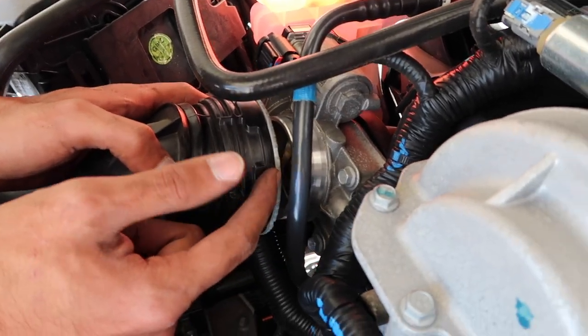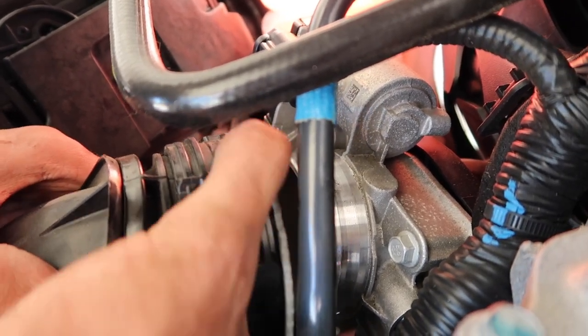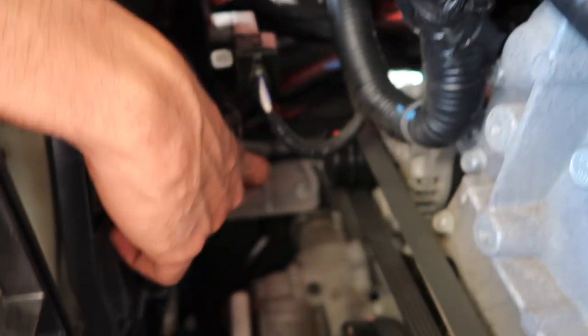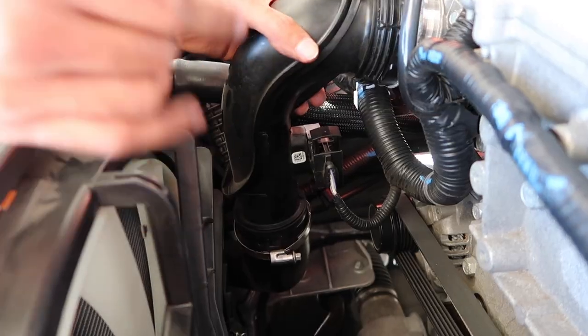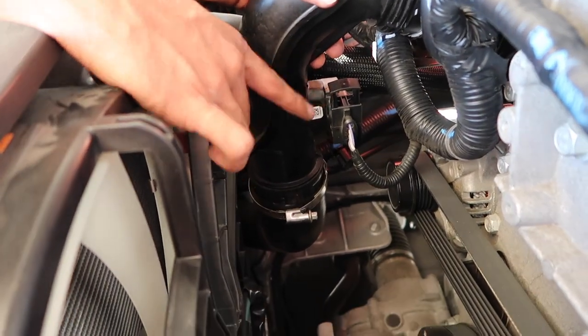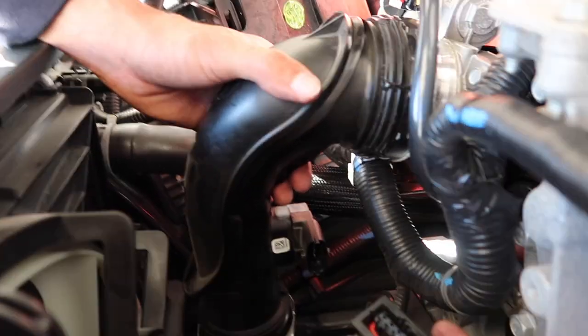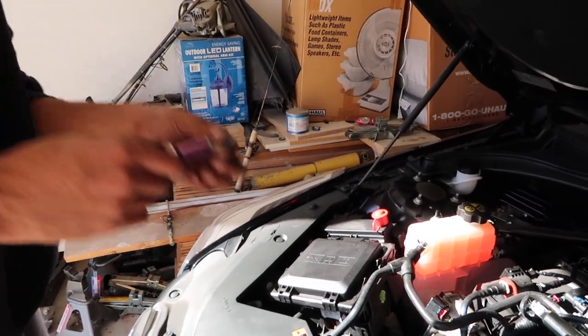A quick little note: if you're going to remove your throttle body, you want to move this actual end of it to the side and it will allow you to get over this little ripple right here. You can simply pull it off and then loosen this as well. I couldn't get a socket on there so I just used a flathead. To remove this sensor, you're going to want to pull this little part up — it originally goes like this — pull it up all the way and the sensor comes straight out. This is going to give you a hard time. I struggled for about 10 minutes trying to take this out — it's really tight around this pipe, but once you get it out, it's out.